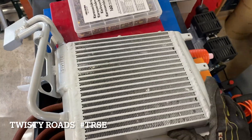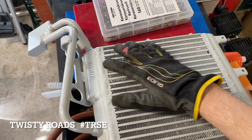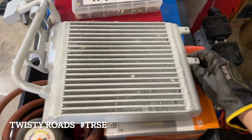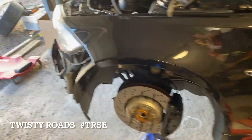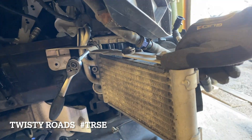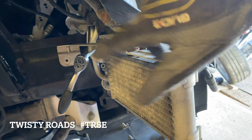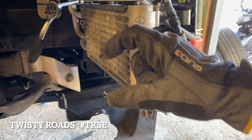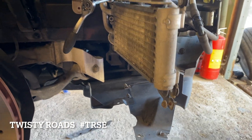Today I'm going to change the oil cooler to the DEO 88 big oil cooler for the M3 E92 DCT transmission. I believe it will fit the N54 engine because I looked into how the stock oil cooler is mounted, and I think every mounting point is 99% the same — just a bit thicker and deeper down. We'll pop the oil lines now and see.